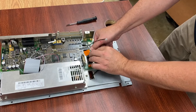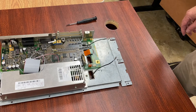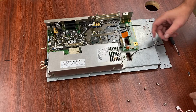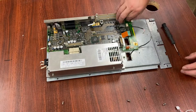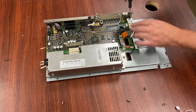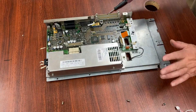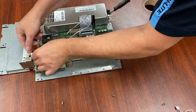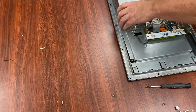We're going to put a new inverter on top of that circuit. Siemens did an odd thing — they built the inverter part in the power supply and part on the main board. By removing that red wire, you're disabling that inverter. We're going to put the Monotech inverter on. That Monotech inverter puts out 9 to 12 volts, and we take 12 volts from the power supply. We provide an extra little cable that goes right into place, and that provides the power for the new LED inverter.